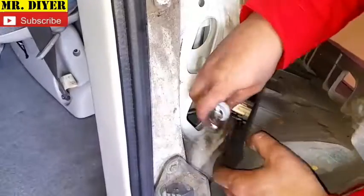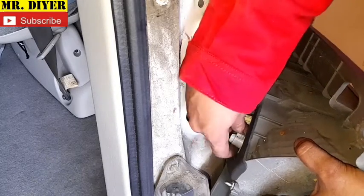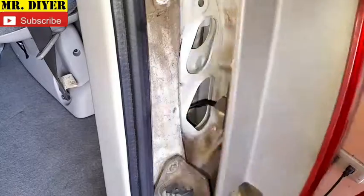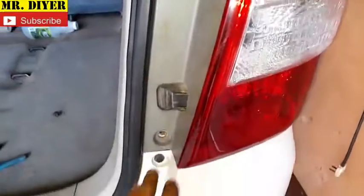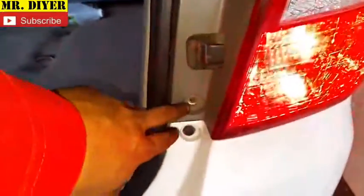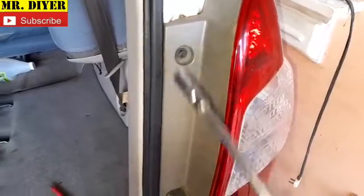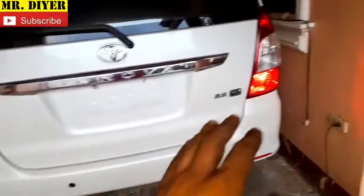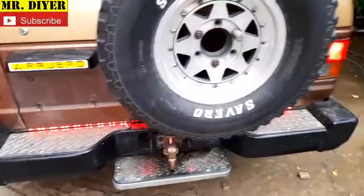Release. We can now move this light inside its housing and twist to lock it in. We can now put the taillight assembly back in place. One last check before we bolt it in — same procedure, check our brake lights. It's lighting here and it's lighting there. So we can now finally bolt this back in.